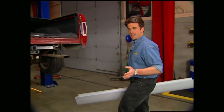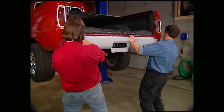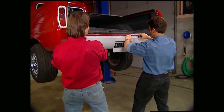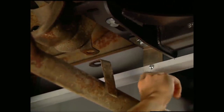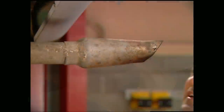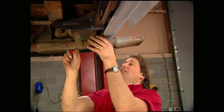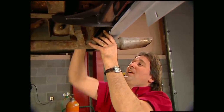With the hitch in place, we can go ahead and put on the roll pan. Don't be afraid to use shims to make sure everything lines up just right. You also have some brackets that support the bottom of the pan and bolt right up to the hitch supports. Once we got rid of that old bumper, the exhaust pipes hang way too far down below the roll pan, so we need to raise them. Fortunately, this system has enough slack that we can raise it up and remount it to the frame without cutting it — and that's really nice because even though these pipes may look bad, we still have some miles left in them before we have to change the system.